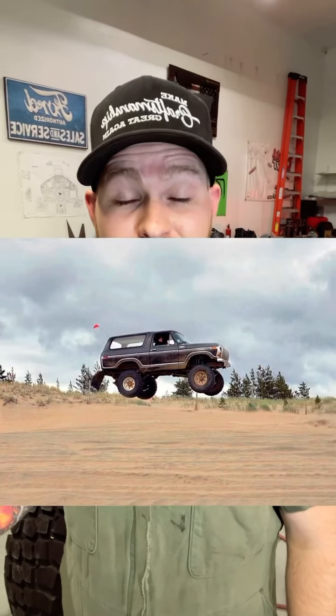I skipped it on my '79 Bronco that I drove through high school. I had a set of 4-inch lift Deaver springs on it, getting the same shocks everybody else was running. The packaging was all wrong. I never cycled it, but I definitely found out when I jumped it — my rear shocks were blown out and a cross member was just bent and mangled. Cycling and doing a little bit of work on the front end of a build is going to save you a lot of grief later on.